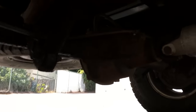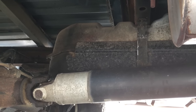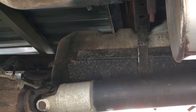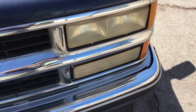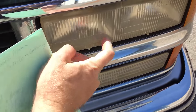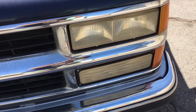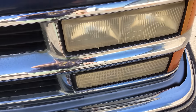The fuel pump tends to go bad around 100,000 miles, and it is on top of the gas tank, so you have to drop your gas tank down to replace it. I would recommend if you've got one of these with over 100,000 miles and you don't know if it's ever been replaced, proactively replace it rather than getting stranded in the middle of the woods. The plastic headlights get hazy too — you can polish them with baking soda and toothpaste or a polishing kit, or buy replacement units at AutoZone or eBay.